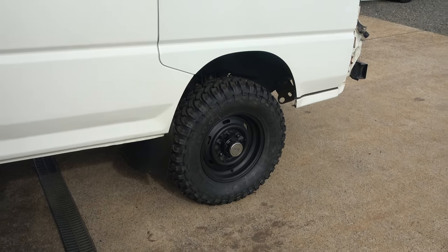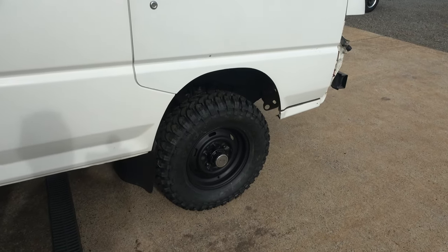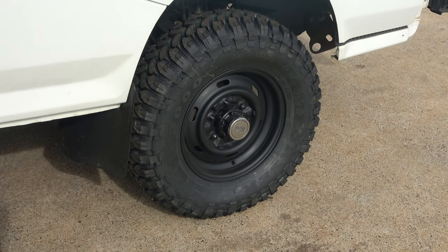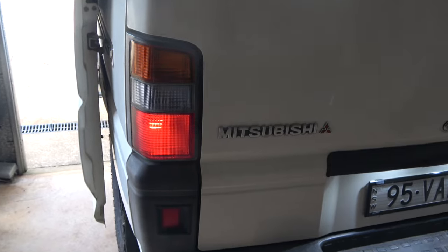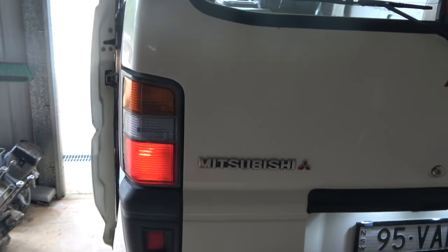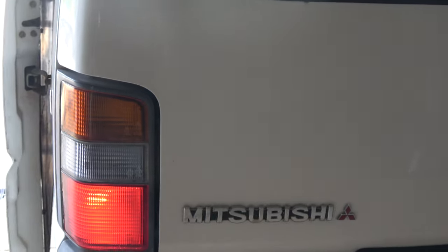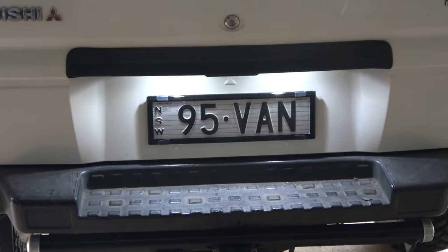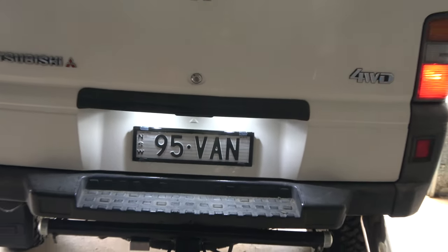You may have also noticed I fitted my new tyres on the factory standard steel wheels, which I found — I had to go on a 400k round trip to get them. These are the factory standard wheels that came out on this van when it left the factory brand new. I've also changed all the back lights to LEDs — LED brake lights and reverse lights. The indicators are not LED because it causes other problems due to the lack of resistance; it's actually easier to just keep the indicators as standard globes. You can see the LED number plate lights there, and I did order myself some personalised number plates for the van — it is a 95 van, four wheel drive.